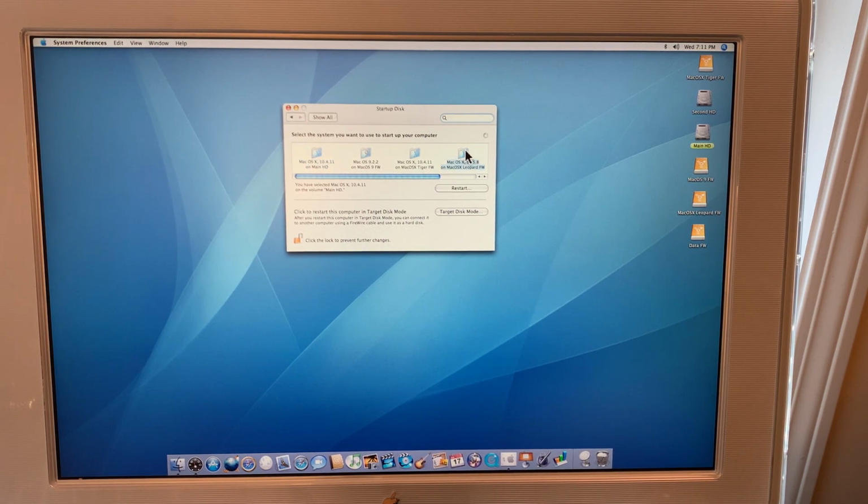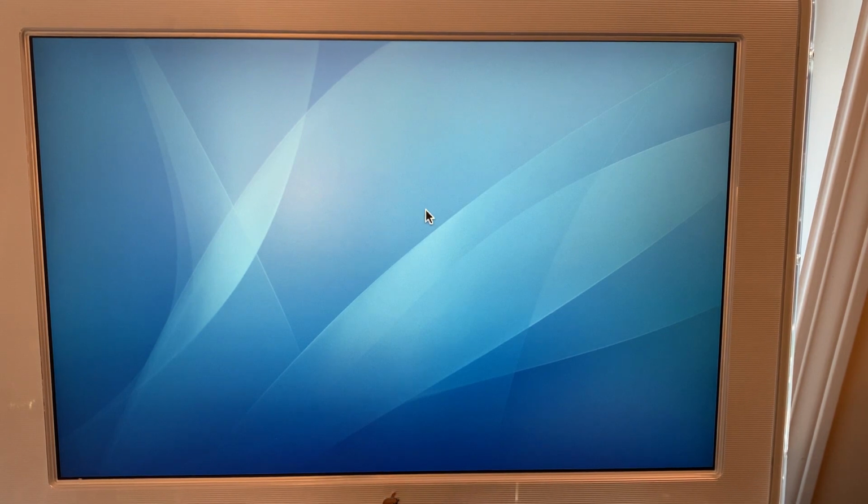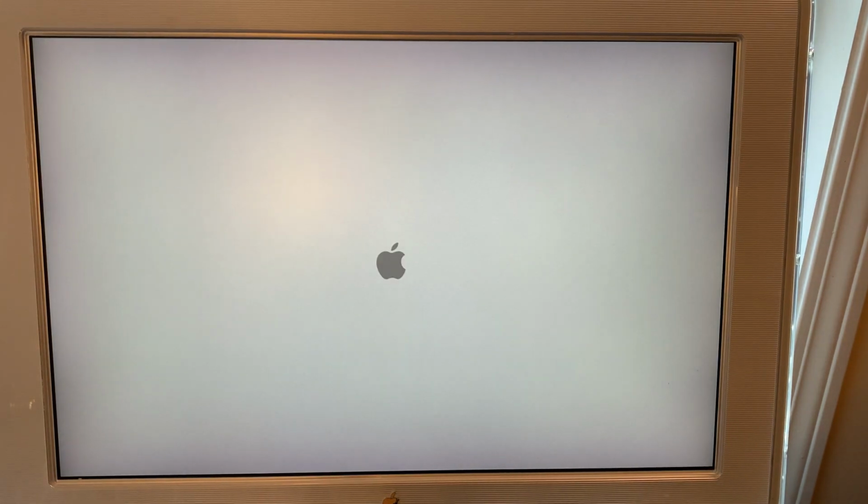I'm okay. I'm in here. I'm curious. Is it going to boot Leopard? Depends on the firmware. If it's had the firmware update, it'll be able to boot Leopard. If it hasn't had the firmware update, it won't. It'll kernel panic. I discovered that installing. Yeah, actually, it was my other now gigabit Ethernet.